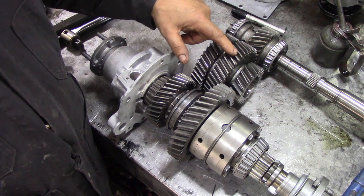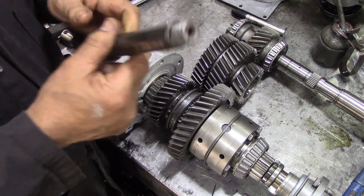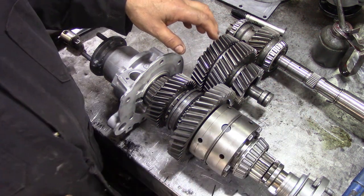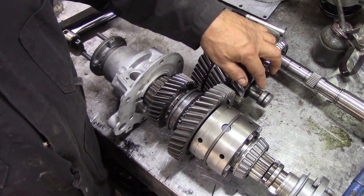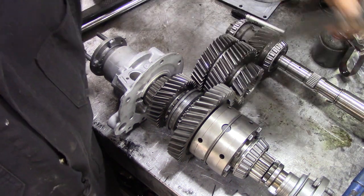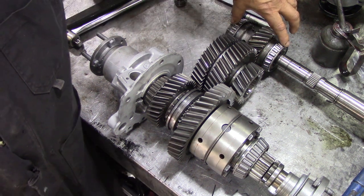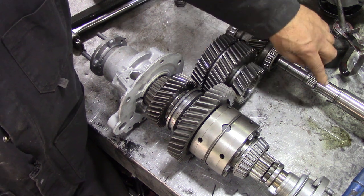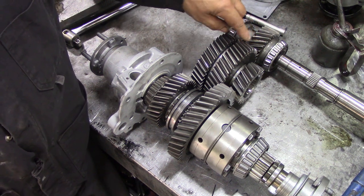This gear drives the intermediate shaft, which runs on a pin. There is an awful lot of torque and twist on that shaft — that's why transfer cases leak where that pin goes through. With the taper bearings set properly, the clearance set properly, and a nice new spline, the only play you're going to get is between the gear teeth — negligible, hardly anything.